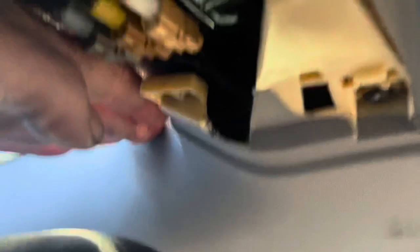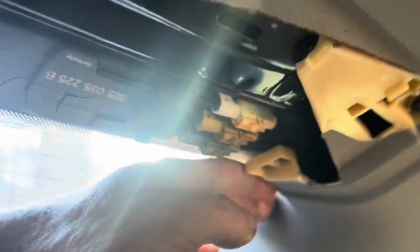In order to do this, you need to pull the rear panel off the back of your headliner — the very rear panel right above your headrest. Pull straight down on it and it'll come off. As you can see, it's just held in with four clips. One of mine stayed in the roof so I'll have to pull it out with pliers and put it back in. Now you'll be able to see all your connections to your diversity antenna — there are your three connections for the diversity antenna.